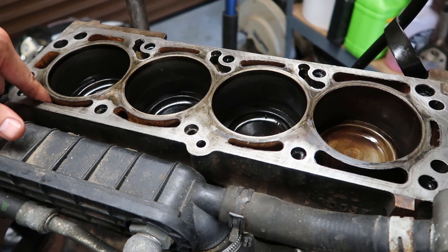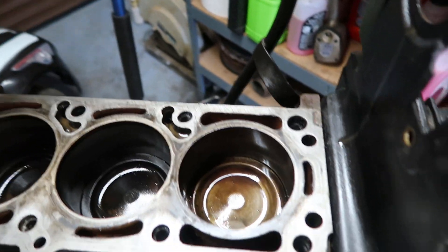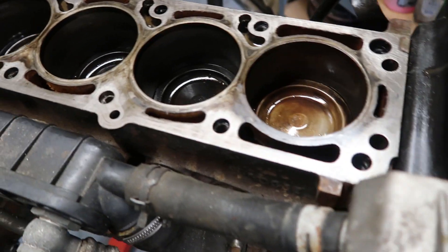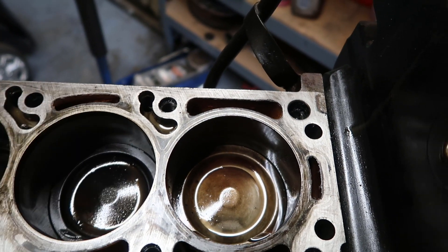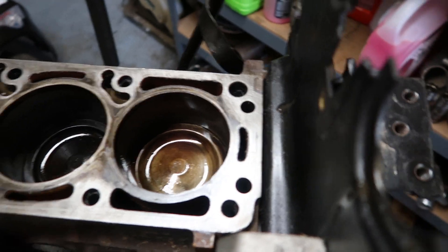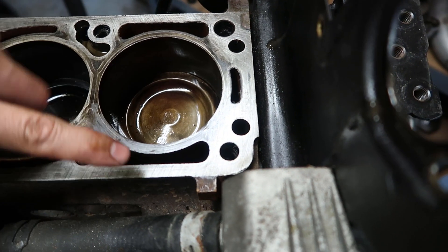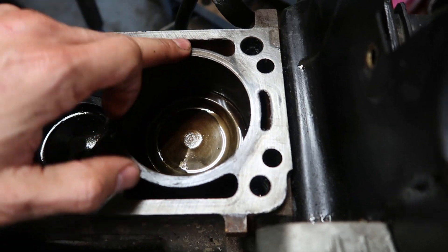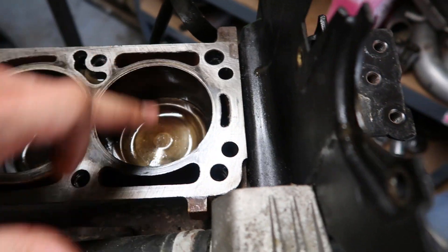This would need to be chemically cleaned in there because twelve thou or 0.3 of a millimetre of corrosion or oxidation can reduce your heat transfer by about 40%. That's pretty serious once corrosion builds up on your water jackets in a performance motor — you're not going to have the heat transfer needed to keep the engine cool. Once oil contaminates your coolant, oil reduces heat transfer again, so it's like a snowball effect. On the Z20, these big open deck water jackets are the weak link — under bigger power these always pop. That's why you wedge your block; cylinders one and four on this one seem to be the worst.